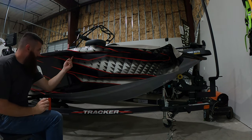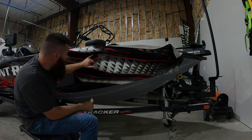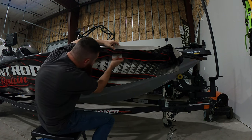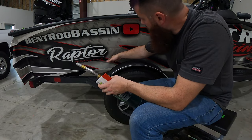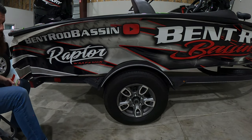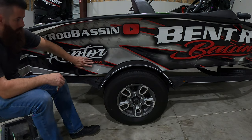Kind of here where I'm making solid contact with that ridge — there is a little metal bridge under there. If your boat doesn't have it then you'll probably hit the bottom of the top cap, but mine's got a little bit of a ridge there which is going to be nice because we'll be able to put our razor blade in there and then get that vinyl chucked up under there. On to the back here — this is the part where it tucks down under. This is all part of the wrap we didn't wrap here yet because we didn't want to cause any tension towards the front of the boat.